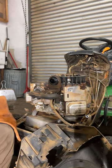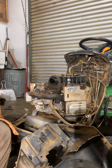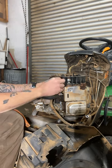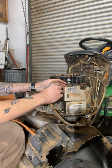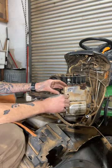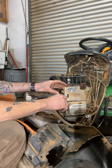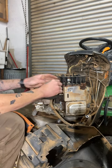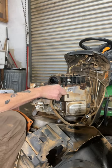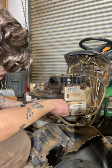I've already taken some out before I decided to film this, but you all can handle that. These also have Loctite on them, so they're going to be hard to take out and kind of hard to get to. Go ahead and pull those off. You can disconnect the fuel line also, and if it's leaking out, you can use a pair of vice grips to pinch it off. They sell special fuel line clamps, but vice grips will do just fine.